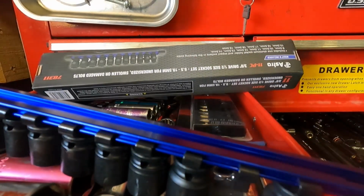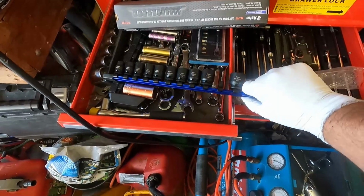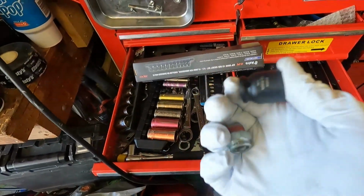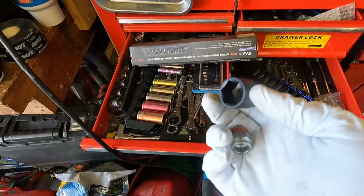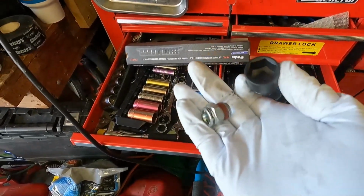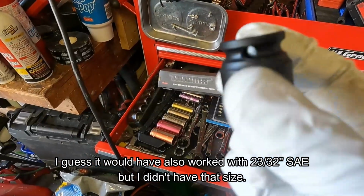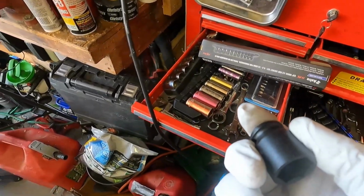Now, I'm still not going to overdo this, but that is just so cool. I said, yeah, you know, I'd rather have it and not need it versus need it and not have it. And of course, I could get this done and put these in with a crescent wrench or something, but I just thought that was pretty cool. There is an application for this. This definitely is not 19, and it's not 18, and it's not the 3/4 or 11/16. So I'm going to use the 18.5, get these adapters installed in the new radiator, and then put that in the vehicle and wrap this up.